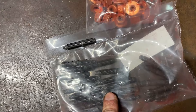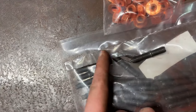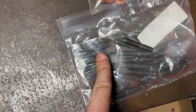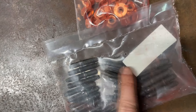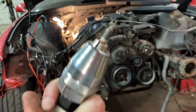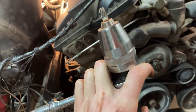The reason I'm pulling all the studs out is because the studs going back in are actually E90 N54 manifold studs. They have a little inverted Torx — like an E7 — on the end of them, so they're easier to put in and out. They're actually shorter too, so it'll be easier to get the nuts on with very little clearance on the turbo manifold. Brand new copper nuts and these shorter studs — pro tip: N54 studs, I hear, are the way to go for a turbo manifold. Looks like it's actually working — that's the first one out, about 23 or so left.